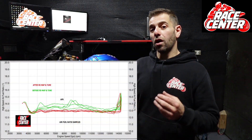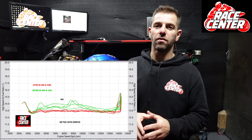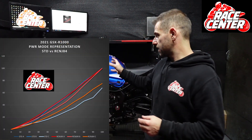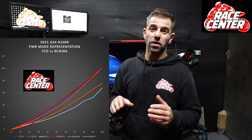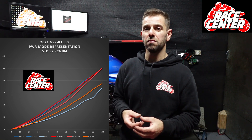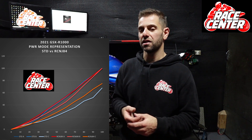Through the whole rev range and loads of throttle positions, we do our static runs, get all the tuning right, get all the AFR right. And while the throttles on this bike are really linear and great, we still do put our NJ84 throttle maps into this bike. On the graph, you'll see that in A mode, our map and the standard map are almost identical. Again, great job Suzuki — it's very close to what we would put in anyway. It's our number one map, so really nice to see.